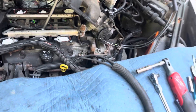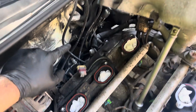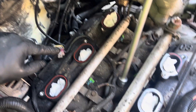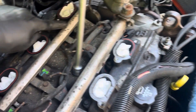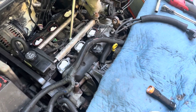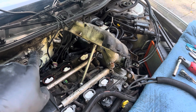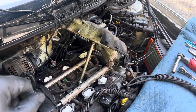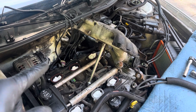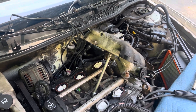The fuel regulator probably needs to be replaced — I did replace it, believe it or not, rusty as it is. Anyway, I've been getting a misfire code on cylinder three. My injector is stuck open, dumping raw fuel out the back of cylinder number three. I took the spark plug out — it was completely covered in fuel. I wanted to make sure I had timing right, hence why you see the fire extinguisher. I had a small little fire, no problem, put it out within a second — had the fire extinguisher right near me because I had a feeling it was going to happen.